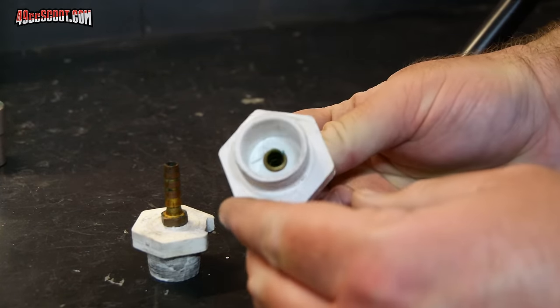That's pretty much your setup — should be ready to go. Before you start putting pressure into the engine, you need to know exactly how much pressure to use. I always work in PSI and go with 6 PSI usually — stick with 5 to 7 PSI. You don't want to exceed that because you can actually push seals out or cause other damage. If you're working with bar, that's about 0.35 to 0.5 bar. Or if you're using a sphygmomanometer that reads in millimeters of mercury, you'll want to stick with about 250 to 300 mmHg.